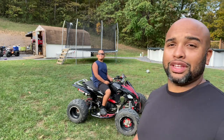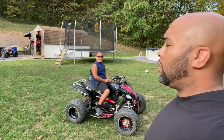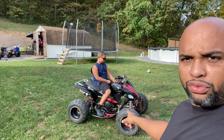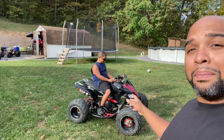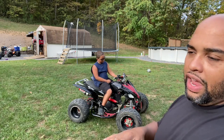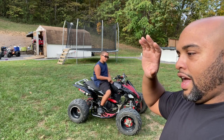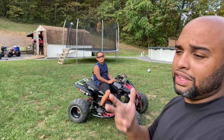We have the Raptor 250 officially complete. The valve seals were a success — it fixed the issue. Over the winter I'm thinking we'll get it powder coated, redo the rims with a beadlock look, and get 18-inch tires on them. This build is complete. Going forward on the next Raptor 250 build we're going to replace the oil seals, rings, and piston so that my buddy who's getting that quad doesn't have to worry about smoking. Make sure to follow that playlist — another Raptor 250. Make sure to hit that like button and subscribe.